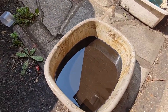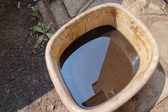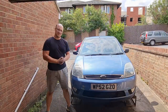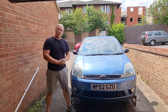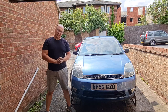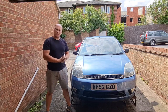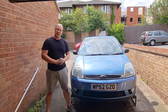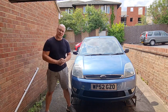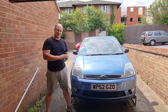Just thought I'd show you this before we end the video - it's pretty manky but it's not got any contaminants or water in it, it's just old. So that's obviously a good sign. Definitely needed doing. That is going to be it for this episode of MEC Tech. We have done a full major service on this and that should keep it in good health for at least another year. I'm probably going to be doing a cam belt on it at some point in the future, so that will probably be a future video. It's all running nice again now - I've had it running and made sure the oil level is still the right level. With the fuel filter, I did prime the pump a few times just to get the fuel back up to the front again as it would have had a little bit of air in the system. It started up no problem at all. Something that usually gets forgotten is that fuel filter because it is underneath at the back - people either don't know it's there or they forget about it.